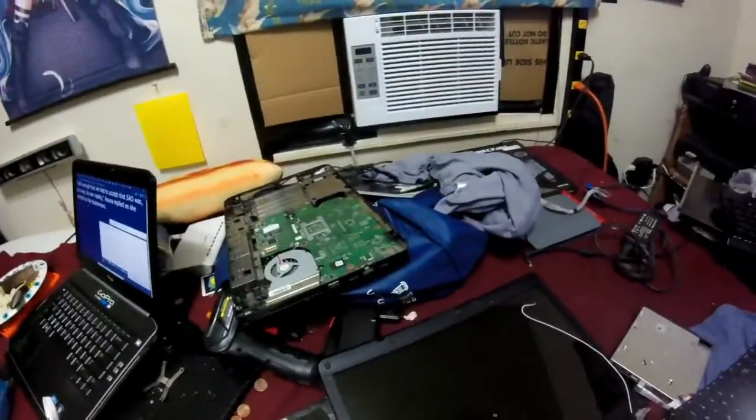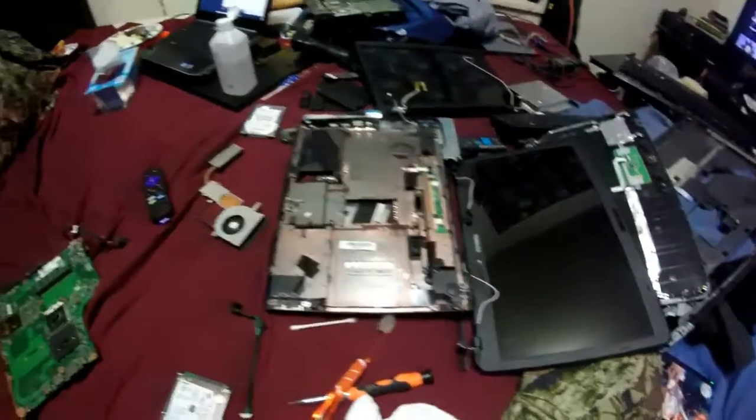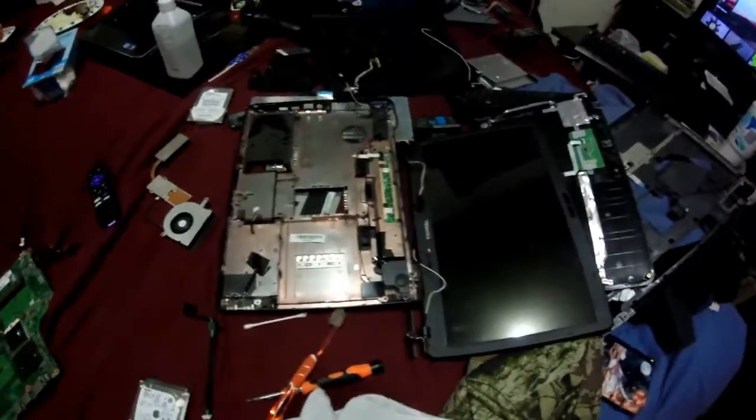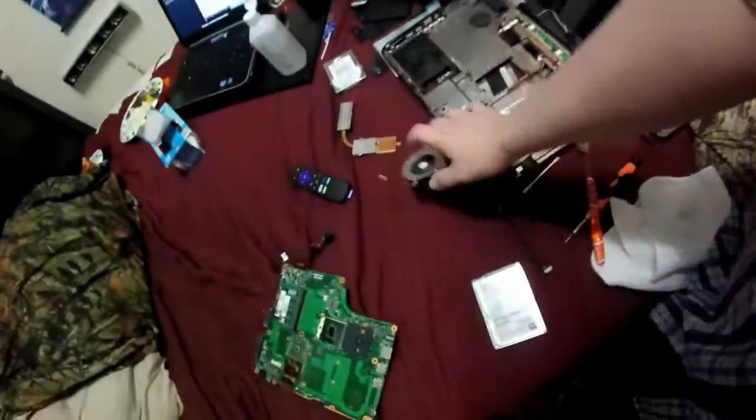There are the guts from the one with the DDR3 for the Toshiba, which is a mixed match. I'm going to use Arctic Silver in this, just in case I have to take it apart again — I don't want to waste the MX-2, which has a theoretical lifespan of 8 years after being applied according to their website. I dismantled and cleaned the fan best I could. I'll show you it all after I get it together and Windows 7 installed. I'm also going to be restoring both hard drives — I already backed up the one that pretty much died. After I get everything installed, I'm going to restore both backups into one user directory. This is the easiest way to make sure they have a working laptop with their own profiles until I can figure out how to fix the one with the backlight screen.